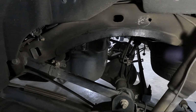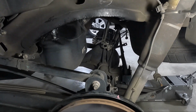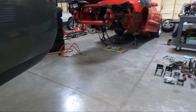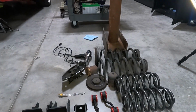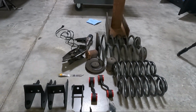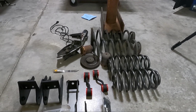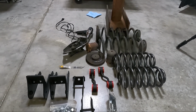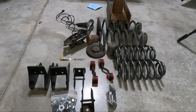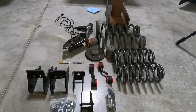Now that we've got that cut off, painted, everything's good, I blew everything off, got both sides cut completely out, we are going to get some parts here. And so what parts are we using? Well, like I said, if you guys have watched me do this before, it's pretty common. I'm using Trailblazer springs, and yes, they are for a Trailblazer, but they do seem to ride really well. I really like them. And so, of course, guys, like always, I'll list all this stuff in the description. Because we're going with that, generally that's 4 to 4.5 inches.